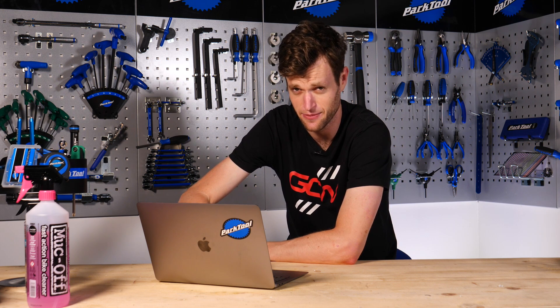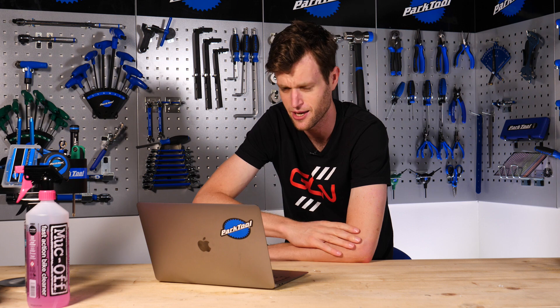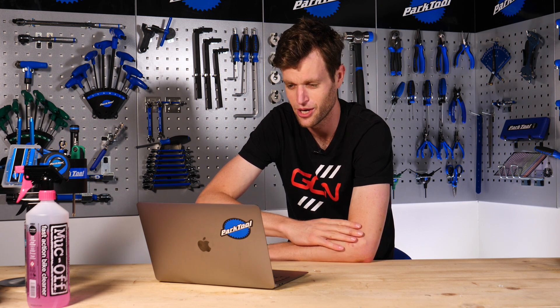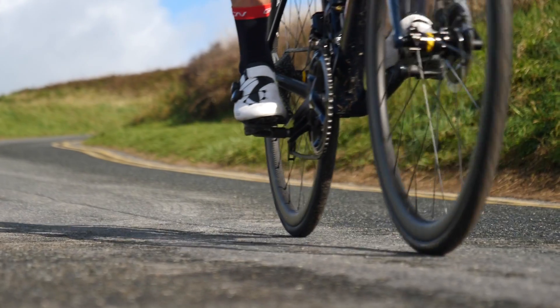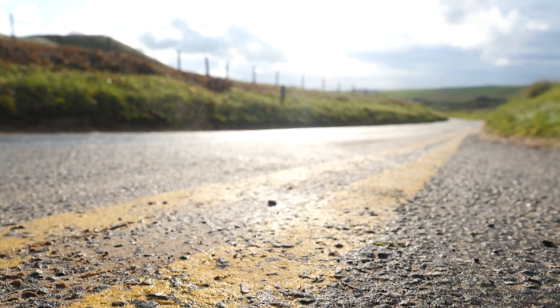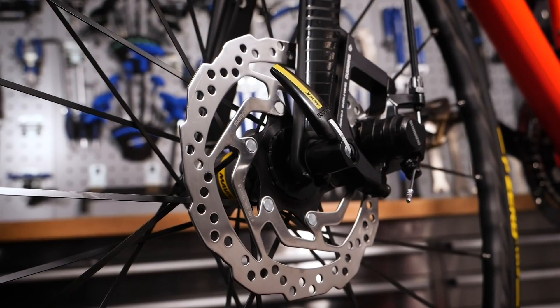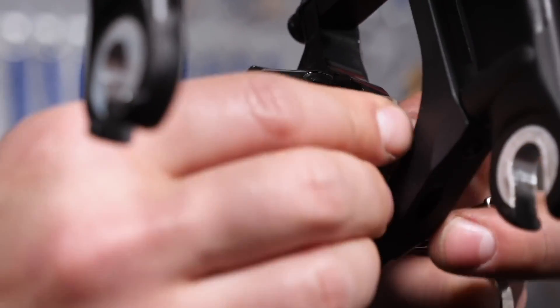Next question by Philippe Shad. My hydraulic disc brakes seem to always be rubbing slightly and let out a terrible squeaking sound when braking hard — so frustrating. Even after releasing for a few seconds, I tried replacing the rotors and re-centering the calipers with no success; it always returns. What can that be? Squeaking or squealing brakes can be because of all sorts of things. A good place to start is checking it's not vibrations — make sure you tighten the rotor bolts and the caliper bolts so the disc is properly secured. You can also apply some copper slip grease to the reverse of the brake pads, which can help stop vibration too.